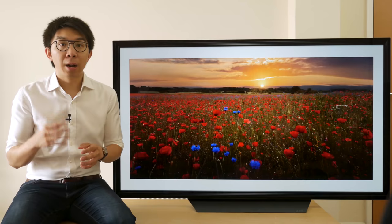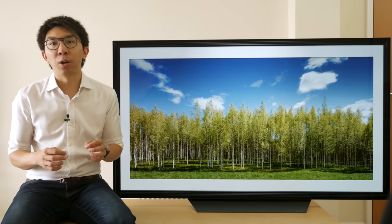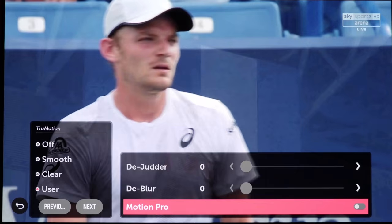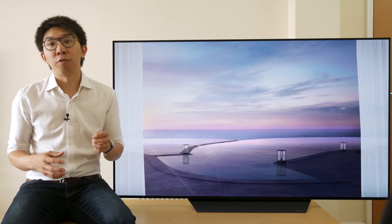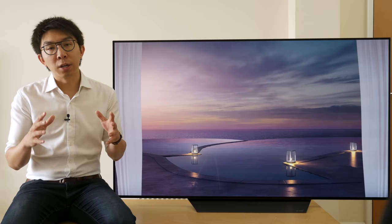Next, let's talk about motion. Like other 2018 OLEDs from LG Electronics, the B8 offers BFI or black frame insertion. When I reviewed the C8 a few months ago, I pointed out that some frame interpolation is still being applied with BFI engaged. This appears to have been fixed or reduced on the B8, judging from our interpolation detector pattern — maybe it's the different chipset, maybe it's the firmware. However, I don't think many viewers will be able to tolerate black frame insertion on current OLED TVs, mainly because of flicker, particularly in brighter scenes with 50Hz broadcast content. I'm one of the biggest advocates of black frame insertion out there, but there's no way I can sit through an entire football or tennis match with BFI enabled on an OLED TV — from LG, Panasonic, or Sony. The flicker just gets too tiring after a while, even if motion blur is reduced.